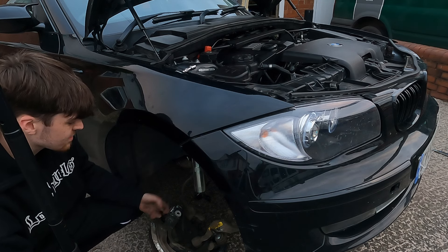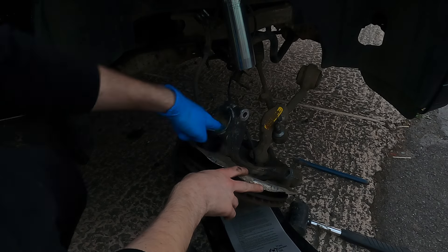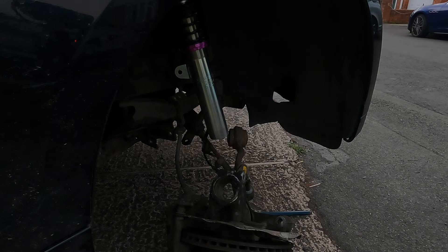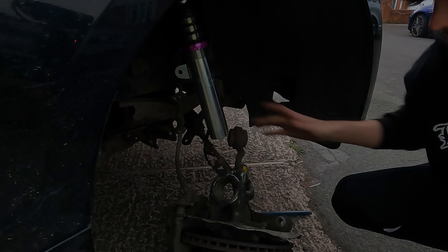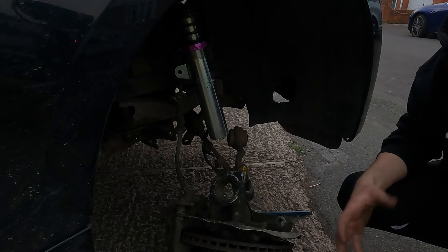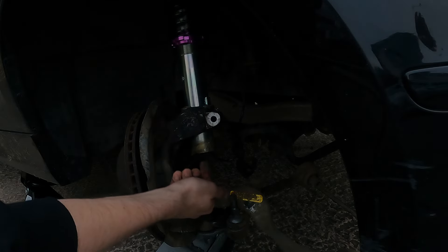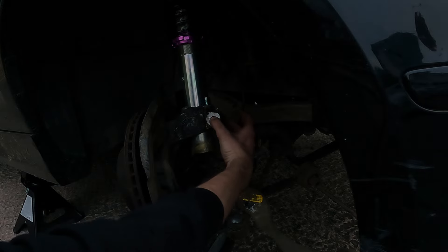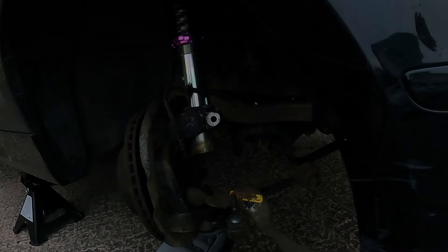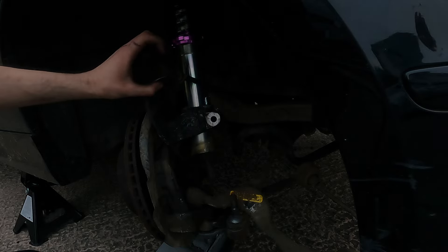With the brand new coilover, there's a little pin that sits up into a hole next to the thread — make sure you have it the right way round. Bring it up from the bottom, look up top, line it up, and get two of the nuts on finger tight, then one needs to be done with a spanner. I'll nip those up slightly with a wrench. Next, grease the inside of the hub so it slides on nicely and will be easier to remove later. I then had to quickly take the hub back off because the brake line clip needed to go around the strut first.